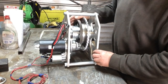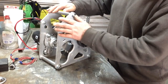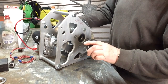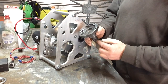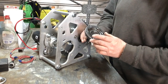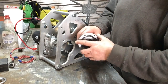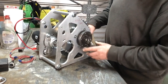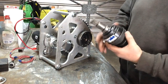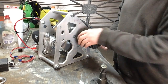This is one of my chain drive units, it has a mounting cradle on it. This is an optional 100mm outside diameter flanged output shaft to take the Lobro type joints that you'd commonly find on Volkswagens, Ford Sierras, things like that. That's one option. The other option you can use are standard Ford Fiesta S-Sport push-in CV joints, like these ones.